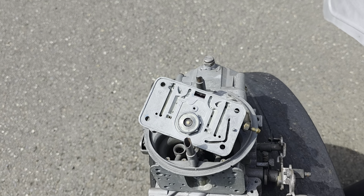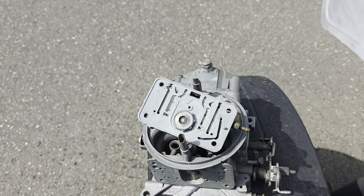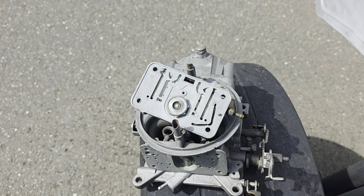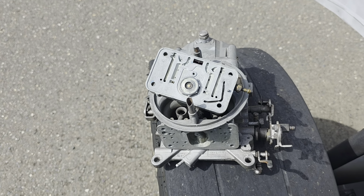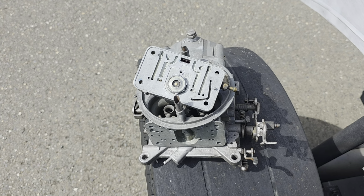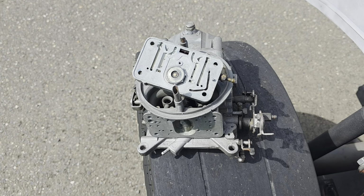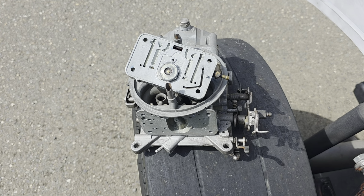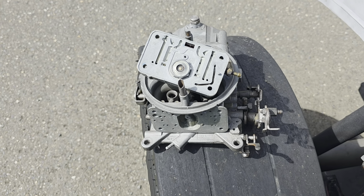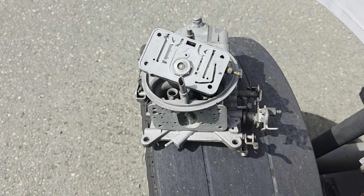So I was extremely frustrated. You know, they were 31s like he wanted, but they were 6 by 32. I mean, they clearly weren't going to fit. I clearly couldn't talk to Patrick anymore. He made me too frustrated. I kind of lost trust in him. I know what I needed to do, so I took the brass set screws that I had already bought, and I drilled them to 31. So that got me close to where I wanted to be, to getting it lean enough in an idle, but it still was not quite lean enough. It just was a little too rich.